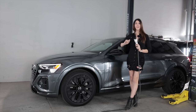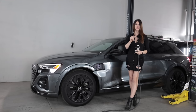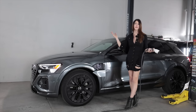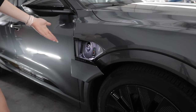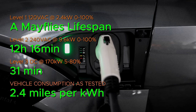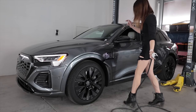Oh, it does have a spare charge cable — this is absolutely genius. The charging door opens robotically at the push of a button. But what if your cord doesn't reach this side of the vehicle? Somebody thought of it, because the other side of the vehicle has an identical receptacle to plug in your charge cable. Charging ended showing 244 miles of range, as it is temperature dependent. Efficiency-wise, if you keep this thing in sport mode constantly in boost, you can watch the miles drop on your range quickly — it'll suck the juice down fast, kind of the same as driving an internal combustion engine hard.